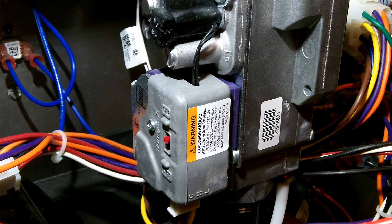That's a much more substantial clunk, as you can hear. That would actually be two solenoids opening: the main gas valve solenoid and also the servo solenoid, which controls pressure to the diaphragm inside. With the gas on, you can hear the gas hiss. You may also notice there's a slight delay between when the solenoid clicks open and when the gas starts flowing — that's intentional, to slow the gas flow so the flame lights more slowly and evenly.